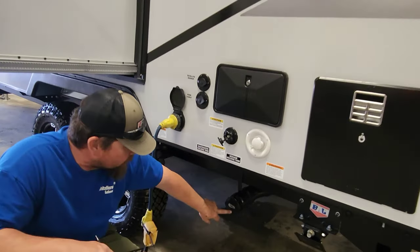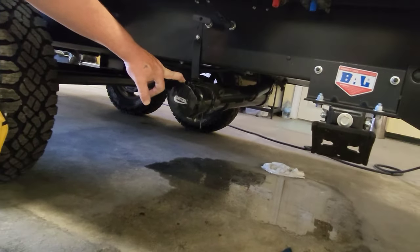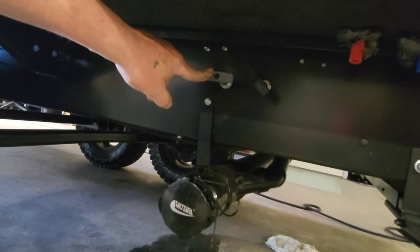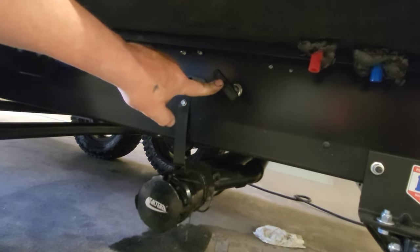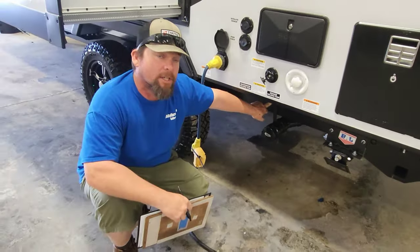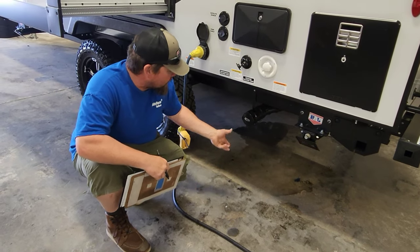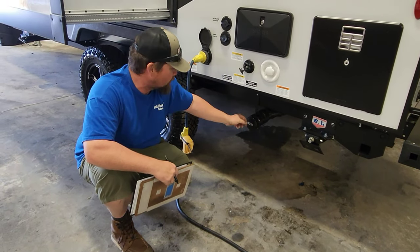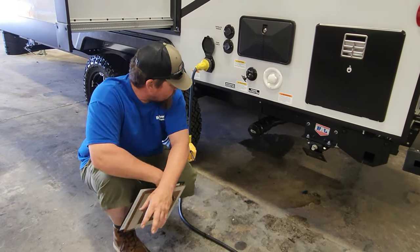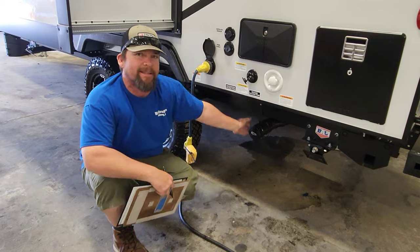This is your sewage drain. This cap is keeping everything inside. The two levers operate two chutes — the left one is gray water, the right one is black water. Gray water means your sinks and showers — usually soapy water. Black water means your toilet. Get your hose hooked up before you start pulling levers, because if you pull the lever first, by the time you unscrew the cap everything will be right behind it. I like to pull the black one first — that's your dirty solids — then use the gray one to rinse everything out.